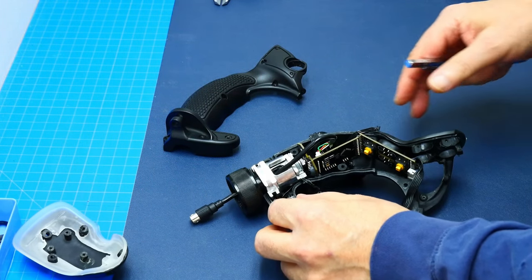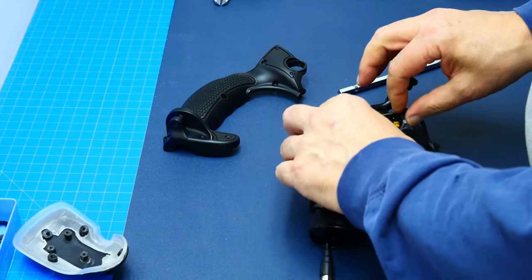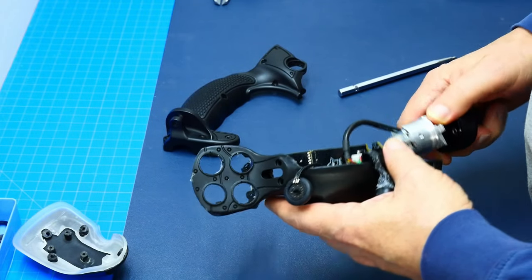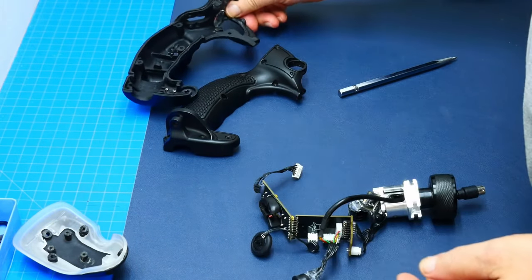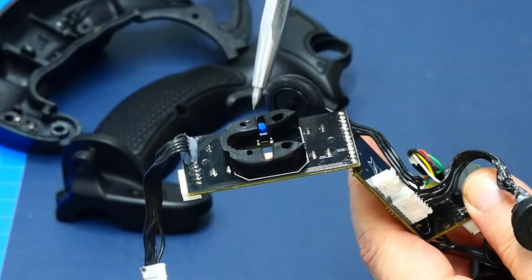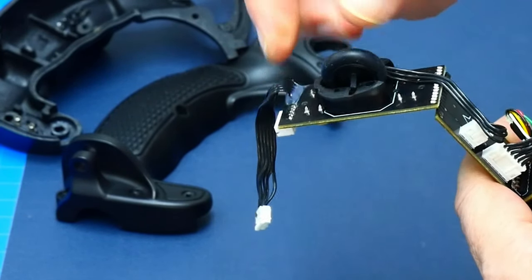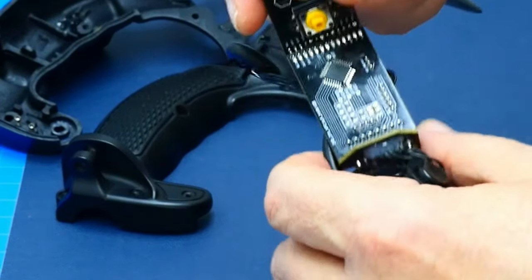Here's the grip and this is kind of how this is all oriented. There was a lot of hot glue in here. Here's the empty shell and here are our components. On this side we have the mouse wheel - there's the mouse wheel cage with two switches in here. The mouse wheel goes in here and you can depress the switch in two stages. Then we have another head switch, and here's the board from this side.